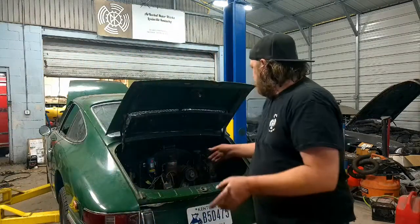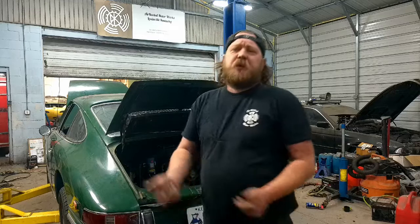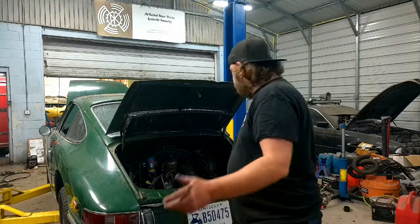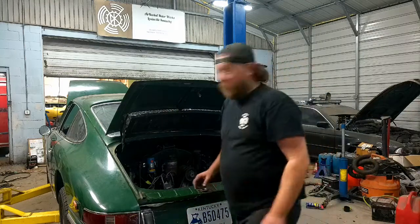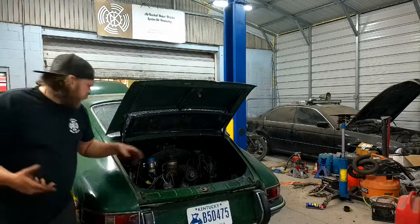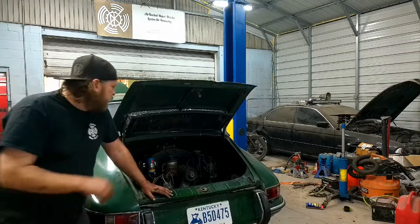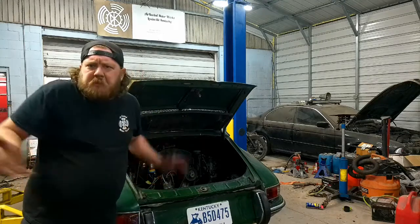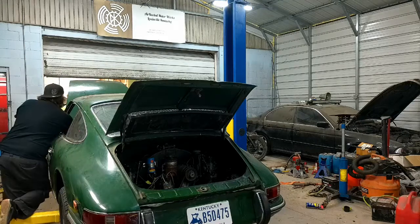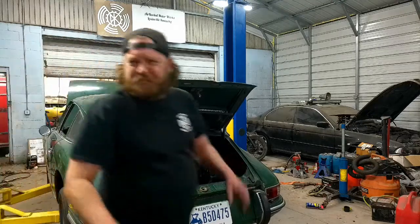All right, what I was saying is I'm gonna let this thing warm up. I don't know if it's picking up on camera, but it's smoky. It's all the lube. You saw the oil in the cylinder. So it's smooth. All right, let me turn the key, see if she fires. There's fuel. What was happening is that bowl wasn't filled. I was revving it, wasn't doing anything. Finally, I guess the float maybe got stuck, who knows. But now there's fuel in it. Let's see if she'll just twist and light off. Kinda.